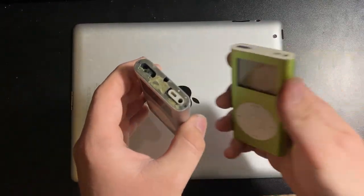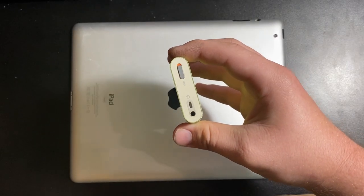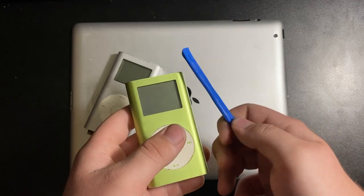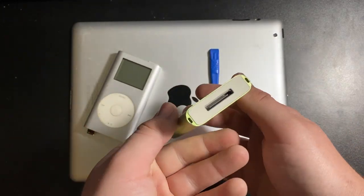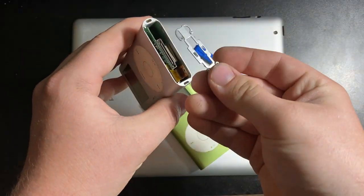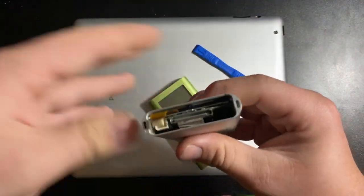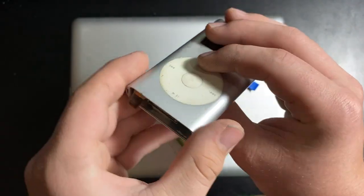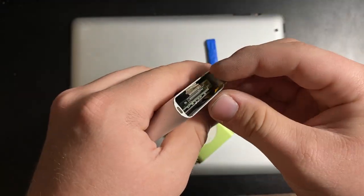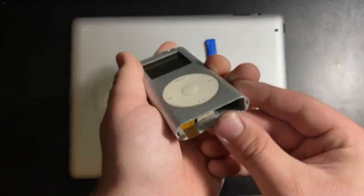What you have to do - there's a plastic thing on top. You put the button in the hold position and then you can basically pry the plastic top off. Be careful with it because there's internals. I used this tool - you can get these in like cheap fake iFixit kits, pretty much the same thing as an actual iFixit kit. The bottom's the same story. There's two screws in the top. Once you get the top off, and the bottom is off, there's a retaining clip that you just have to pop out. Then you get access to the inside where you can unplug this - this is just the click wheel plug. Be careful of that. I use this to pry it open - it could snap so be careful.